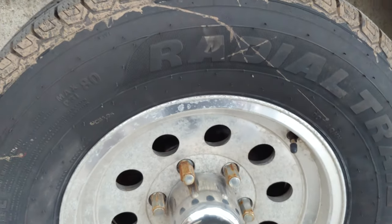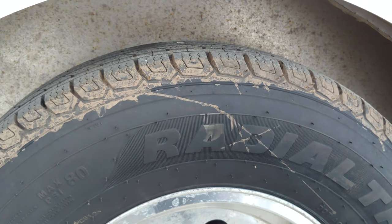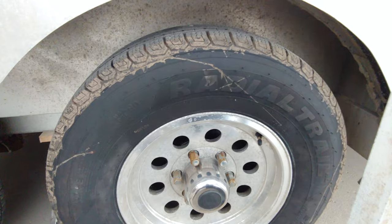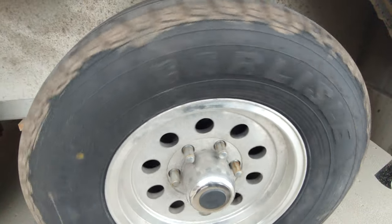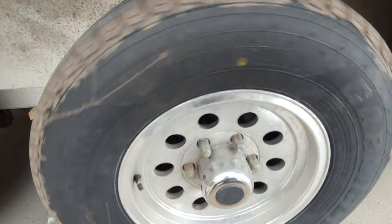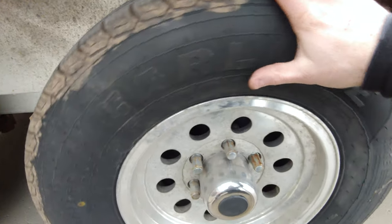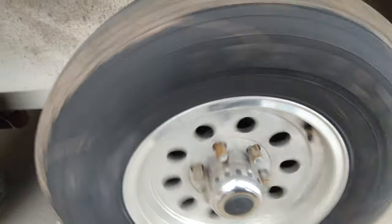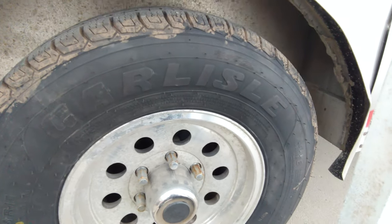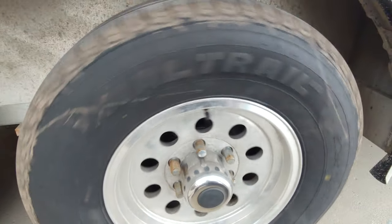All right, so this is the front right wheel. I'll give her the thumbs up to go ahead and hit the brakes once I start spinning it. You can hear that it seems like the brake pads are touching — that's another test, you want to be able to hear them making some sort of contact, but not enough to slow it down. And then you also want to make sure that it'll stop when the gain is pressed. Oh yeah — good deal. All right, so that's good.